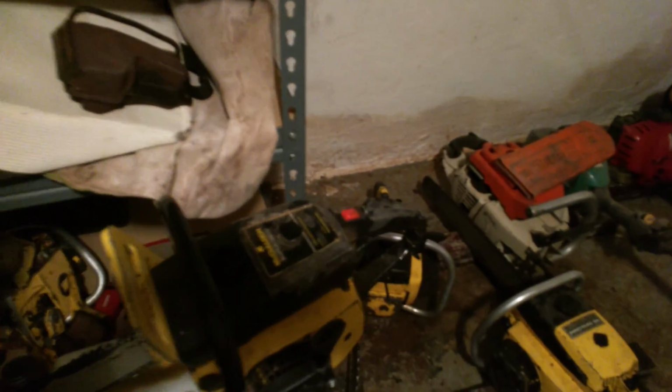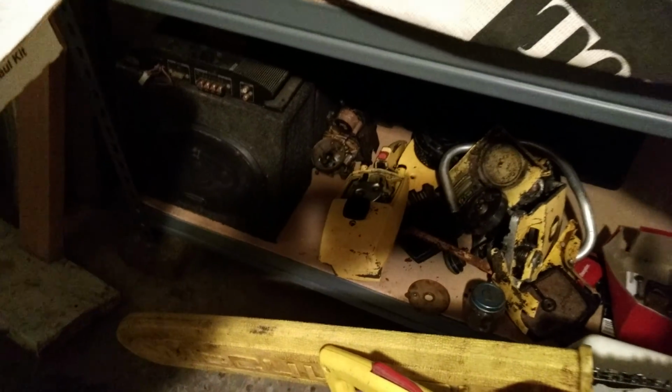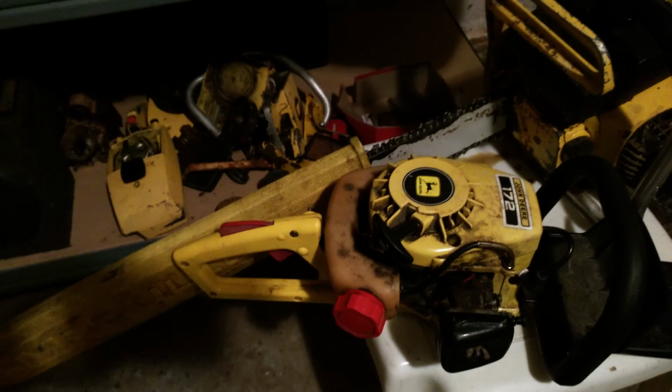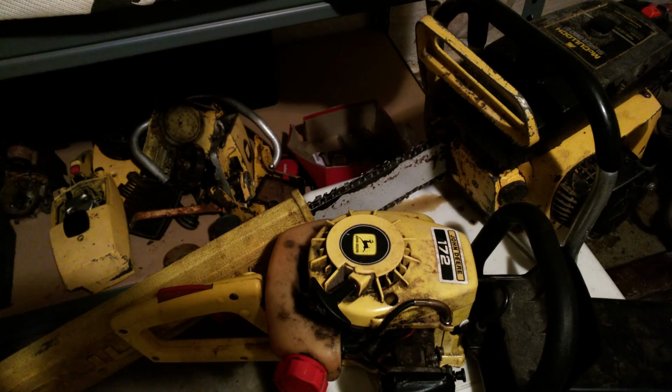There's a 60 or 62 cc ProMac 60. ProMac 55 is actually 57.4, I believe, and the 1010, what's left of it, is 54.3 cc's. Super Pro 81, I think, are about 82. And then again with the Echo hedge trimmer, the HC 1500, which is one of the early gens of those, made for John Deere. The John Deere badged it as 172. That's again the 21.2 cc engine.